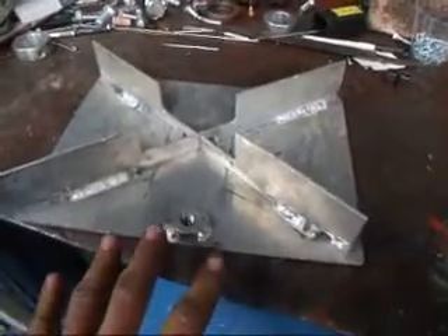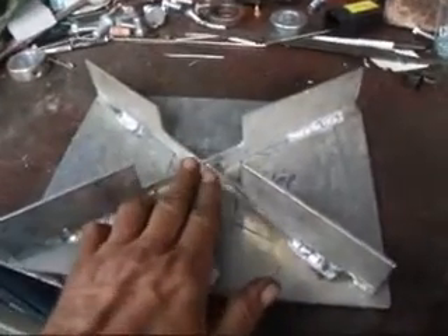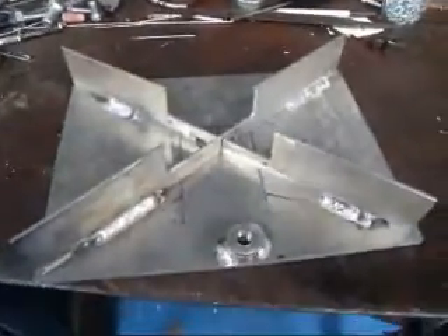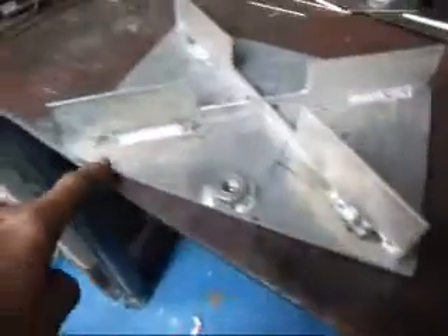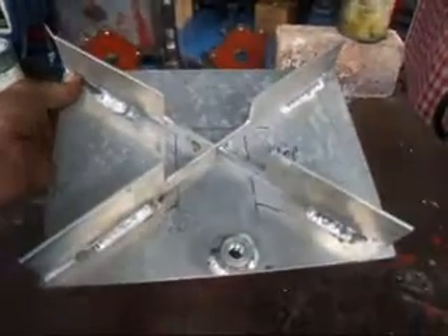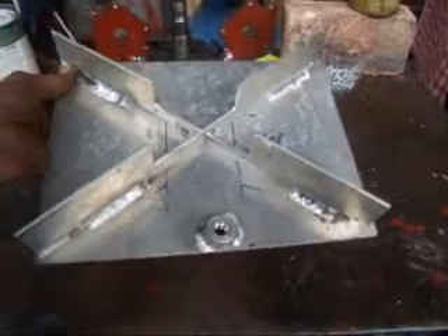As the oil sloshes from either front to back, it's going to be forced up to the oil pickup tube, which is going to be right here — and that works out very, very well. We've also got some more oil relief holes in here to allow oil to drain out, because when you pick up the car to drain the oil it's going to lean back, and we want to make sure we get all the oil out so that we can get it changed.